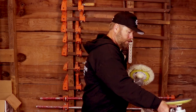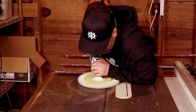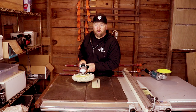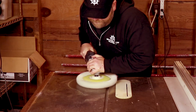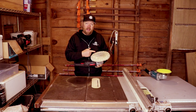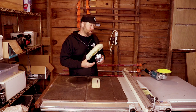What does a no-load machine really mean? Let me show you. I'm going to set this at 1500 RPMs — this is where we'd typically be compounding or polishing. No matter how hard I press on it, it's going to continue to spin at 1500 RPMs. Now the Harbor Freight machine is not a true no-load machine — it's going to speed up and slow down the entire way down the boat. It simply does not have the power of the Makita. It will get you by if you're willing to go back over some areas, but it certainly will not do it as well.